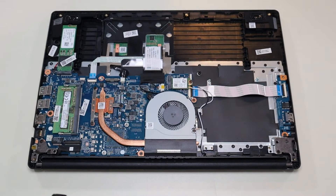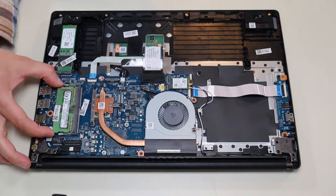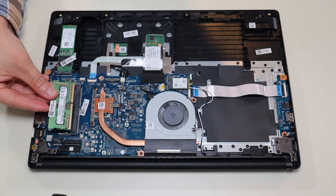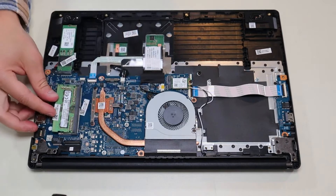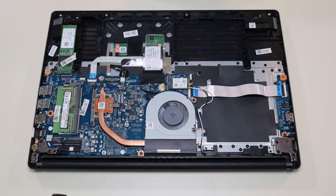The RAM is right here — you have a single port. The way RAM works is there are two metal spring-loaded arms on either side; you pry those apart and the RAM stick releases. There's a long end and a short end so you can only insert it one way. This was a DDR4 8GB stick. There is 4GB of RAM soldered onto the motherboard, making a total of 12GB — and unfortunately 12GB is the max for this computer, so there's no point in upgrading your RAM.